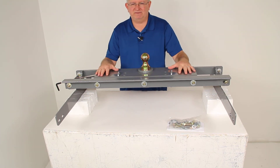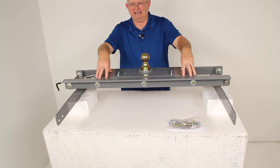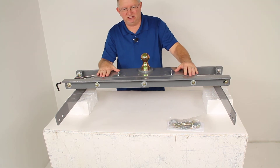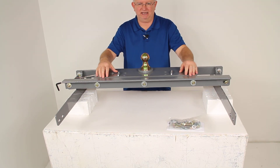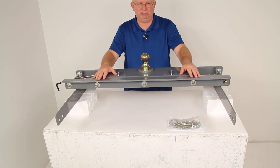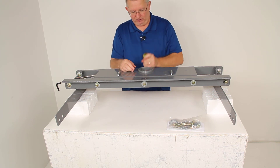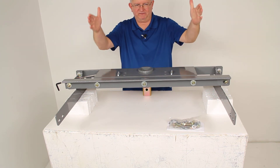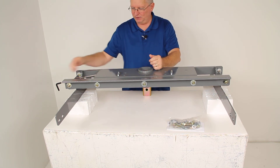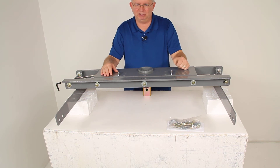This is specifically designed to use B&W accessories that we sell separately, making it very easy to customize this hitch to fit your need. One of the popular accessories we sell for this is the B&W Companion 5th Wheel Hitch. Basically, you can remove the ball and drop that 5th Wheel Hitch in your truck bed — the square base would slide right into this opening, you'd lock it down, and you'd have a 5th Wheel Hitch in your truck bed to tow a 5th Wheel trailer.